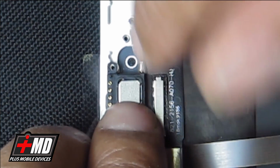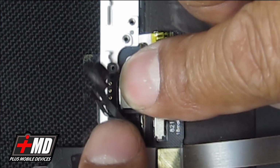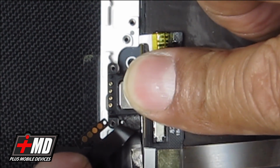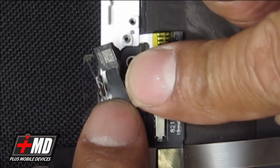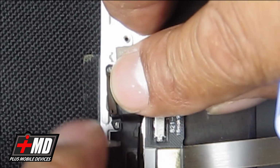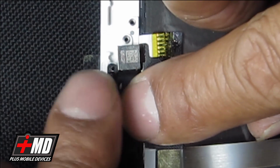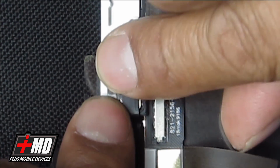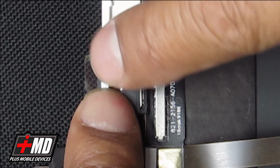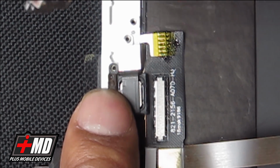Okay, and these top screw holes, one here and one there, are exposed. And now you have these contacts, these spring contacts, there are 4 spring contacts, and there's 4 receivers here. Make sure they all line up, and there's also a dimple and 2 spurs to actually align them. So go ahead and move it around until they match. Okay, now you got the dimple and spurs in. So what you want to do now is go ahead and put the bracket back on.